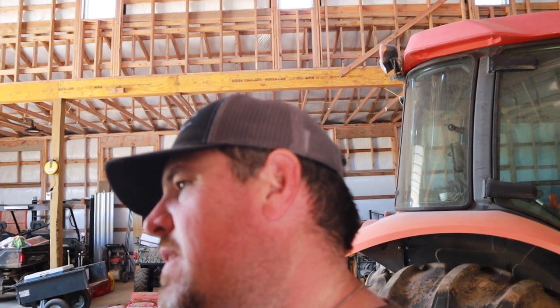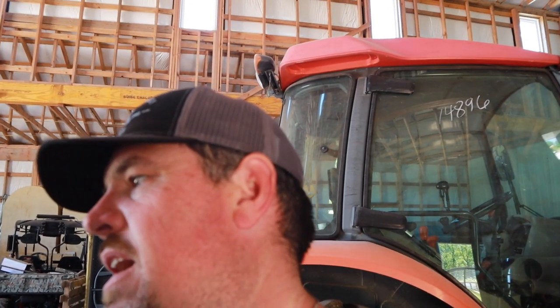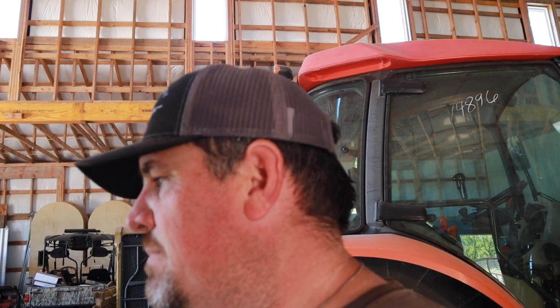Okay. And from the time that I cut the transom out to right now, if you want to take this on, if you have a dedicated week to do it yourself, the process would probably take about that long. We built it up with a ton of layers of fiberglass. I'm not worried about the structural rigidity or structural integrity or structural soundness of this transom repair. I think it's going to be just fine, especially for the size of motor that I'm going to put on it. And overall, I'm really happy with it.